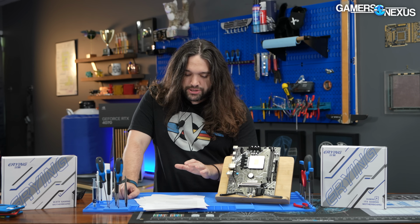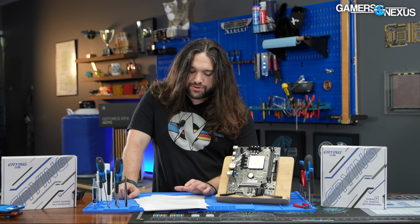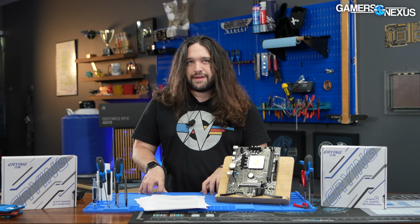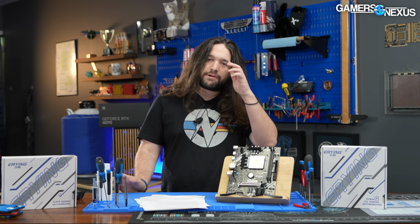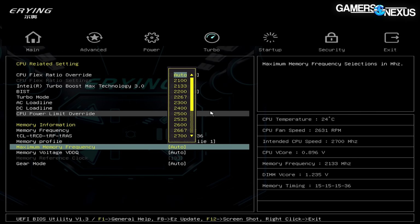We dropped it to Gear 2, and we would guess that this has to come from some combination of the mobile IMC being different and of limitations of the BIOS or just stability of the platform in general. It's 3200, which sounds slow by today's numbers, but DDR4 3200 with tight timings, it might take some additional tuning for it to work successfully on a board like this.